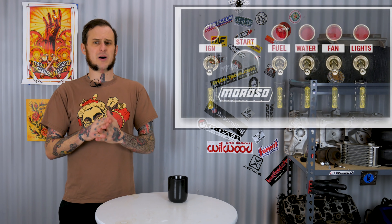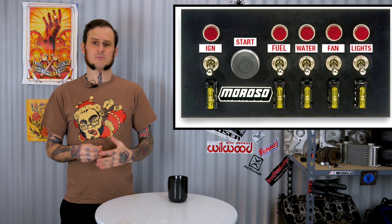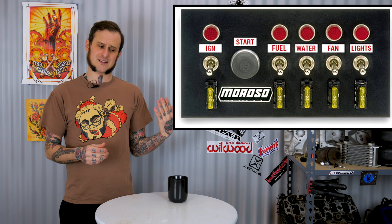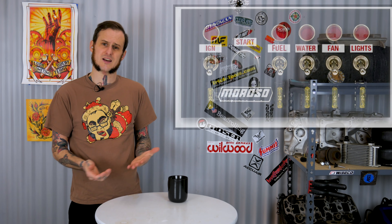You need to think about reducing the distance that voltage has to travel. Power's coming from your battery, going to your fuse box, then from your fuse box to your ignition key — or from your key to your fuse box, depending on how the circuit's wired up. Then you've got to send that power from the fuse box or the key to that fuel pump through a fuse. That's straightforward and it will work. A lot of people do this in race cars and I don't agree with it, but there's a way better way to go about it. The proper way is to use a relay.